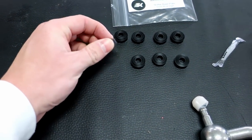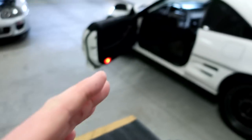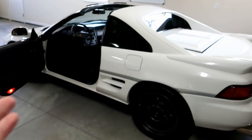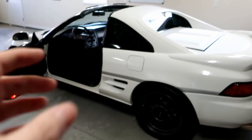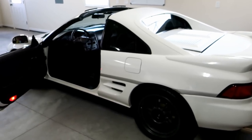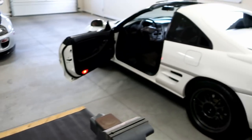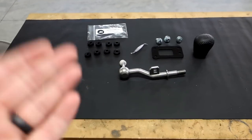Once I get in there I'll show you — the factory bushings are rubber and they tend to move around, which gives it a sloppy feel. MR2s are like front wheel drive cars: the motor's in the back and has pretty much the same layout, except you have cables that run to it — that's how you shift the gears. There are so many more things that can go wrong and make the shifting feel like crap. The car has a '93 shifter, which is a pretty coveted shifter, but this should change it.